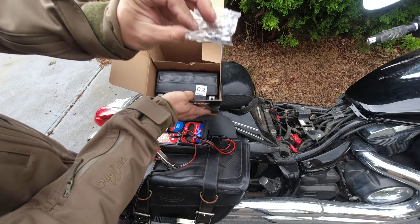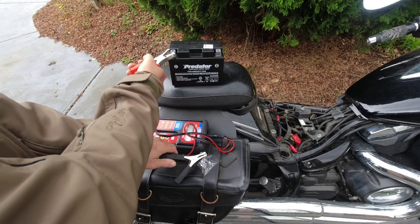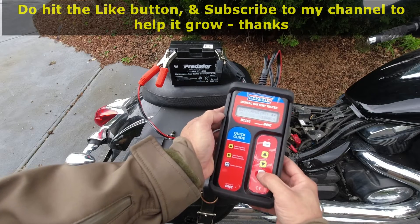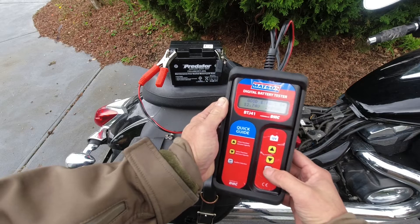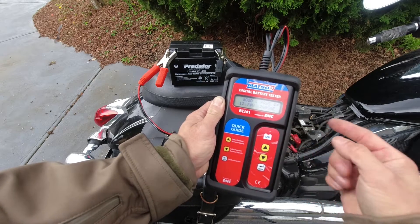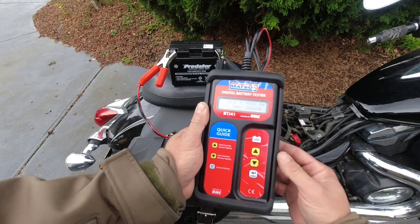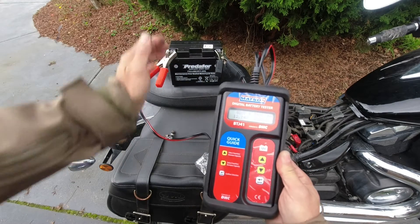Spacer box with nuts and bolts for the terminals and the battery. Let's connect the battery tester to this. Battery tester is connected to the new replacement battery. It reads 12.75 volts. Press enter. It is a valve regulated lead acid battery, so press enter. It is rated at 11.2 Ah and I've set it as 11 Ah on the tester. Press enter. It says good and pass — 12.74 volts, 260 SAE cold cranking amps. So the cold cranking amp capacity of this new replacement battery is double that of the old battery I'm replacing, and that's why the old battery had problems starting — it was only half the strength of the specification of 230 cold cranking amps. The replacement battery is in good health.